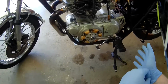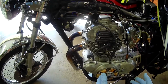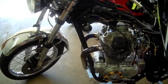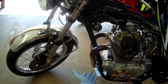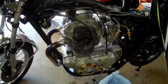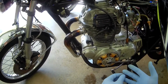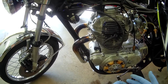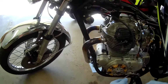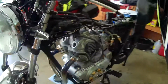But basically, when you do the left side, you want LT, and it has to be on, I believe, the compression stroke. So it's a 4-stroke engine. You can have it on the wrong revolution, basically. One's filling and emptying, and I won't bore you too much with that. It's honestly far more than we need to get into. But basically, with a 4-stroke you can have the top mark on the wrong stroke, and if there's tension there, you're on the wrong one. Give it another full revolution. Not a big deal, and you can feel there's no slack there.